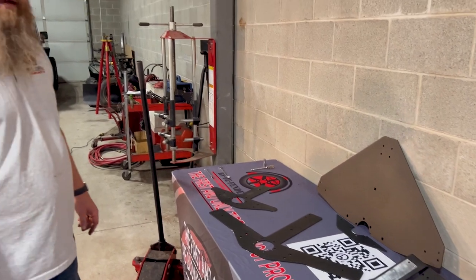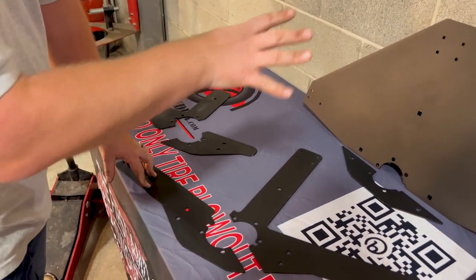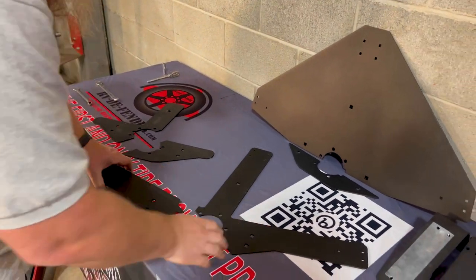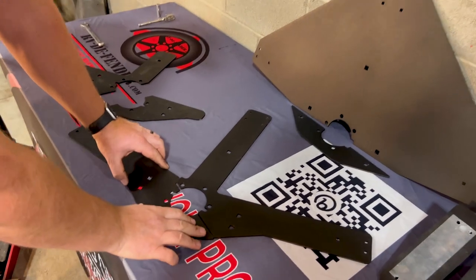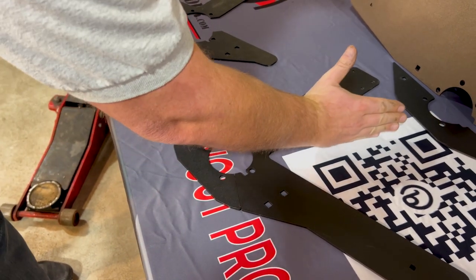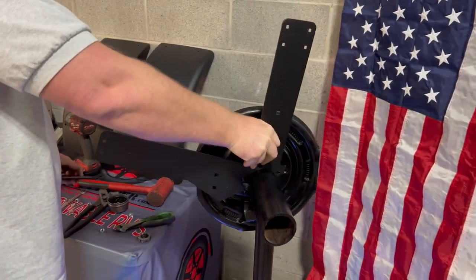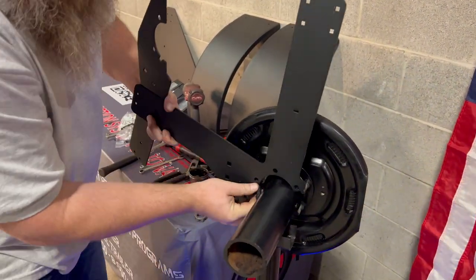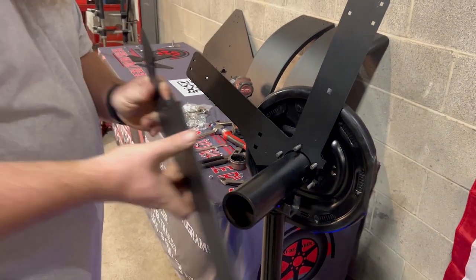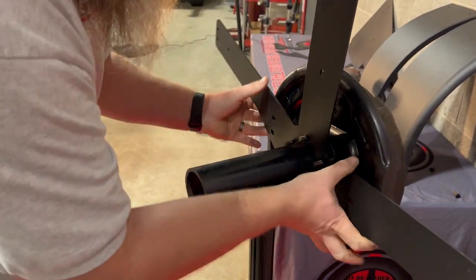Now that you've got all the studs and the sheathing installed on your axles, you're going to want to orient how these install. These backing plates are the same backing plate for passenger side and driver side, but the entire assembly is clocked rearward to allow for more clearance between the tires. Look at these five holes as they make a star pattern — the top one would be straight up, noting that this piece is clocked rearward. Line them up on the holes, being careful to route that wire through the sheeting you installed earlier. Push them over the studs — piece of cake.